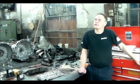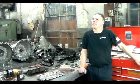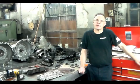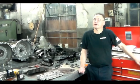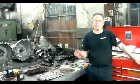2007 BMW X3, 6L45 trans. The car came to me with the complaint of no upshift, at times did not move forward. Also when you put the car into drive, it'll engage and as you start to drive off it'll drop into neutral and you'll have nothing.